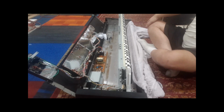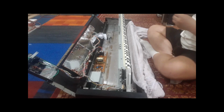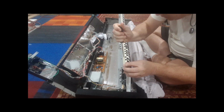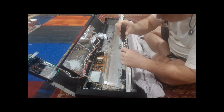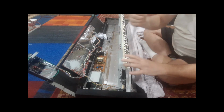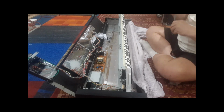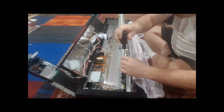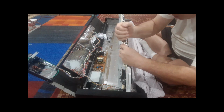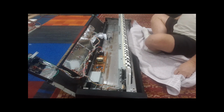All right. Screwdriver. And you install your screws in any order for the retaining strip. And again, if you had a knuckle in backwards, you're going to know at this point, but I don't think you can really get a knuckle in backwards. But the keys can slip, so you don't want these keys to fall at this point. Otherwise, you've got to go back and reinstall them. And we know how much we hate that. So just don't sock these down too much. Just give them a nice torquing. You don't want to strip them. All right, now we're going to take the towel completely out.